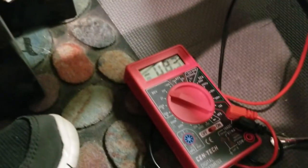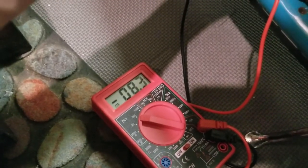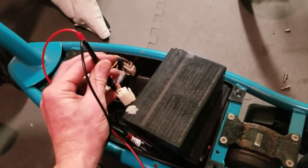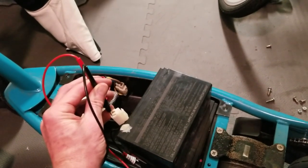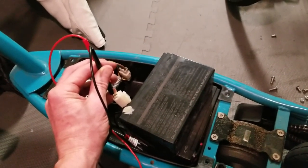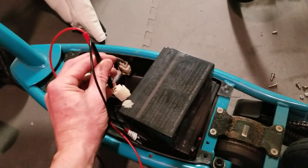Let's go ahead and look at our multimeter right here. This should be fully charged, but we're registering at 0.83. That's not enough juice to make this scooter run, unfortunately. So these batteries are bad. I'm testing this after having this on the charger — 12 hours, maximum 24 hours, no more than that. Then test them before you buy replacement batteries. Unfortunately, these lead-acid ones are shot.